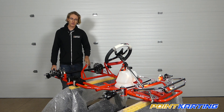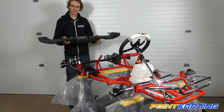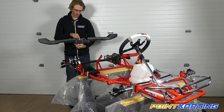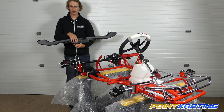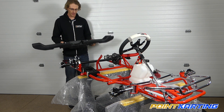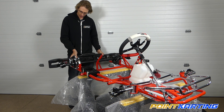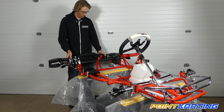I'm going to do that on the other side and then we'll be ready to put the plastic bumper on the rear of this chassis. One quick tip to make sure you're putting the adjustable rear bumper on the correct side: these divots that allow air and rocks to go underneath the bumper need to be on the bottom side of the bumper.